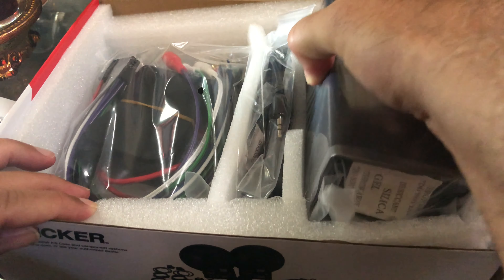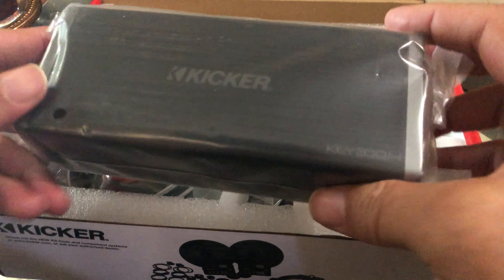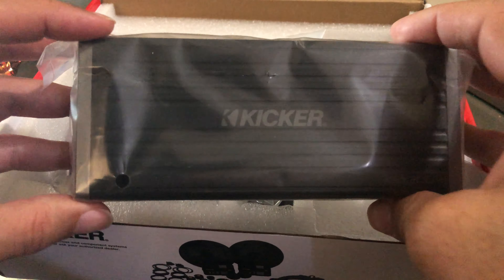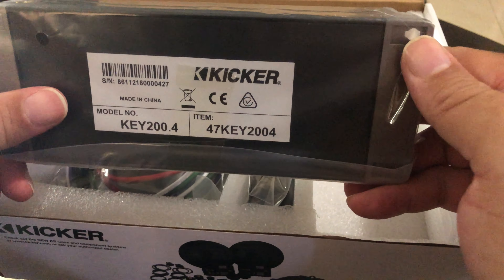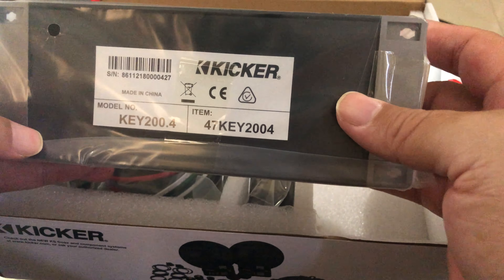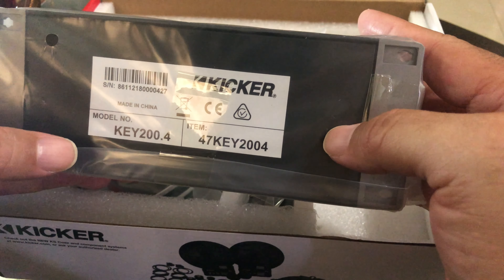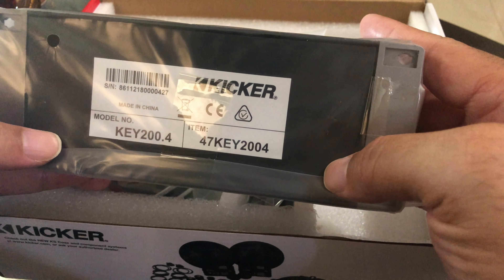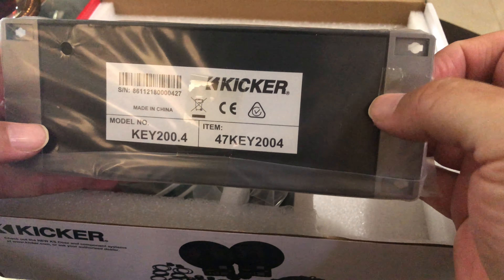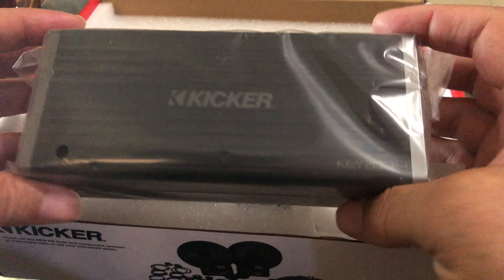What's surprising me with this unit is this thing is small — fairly small — and it's not as heavy as I thought. I thought this thing would have some heft and it doesn't. It's basically 7.5 inches by about 2 inches by 2.5 inches. This is going to fit very easily either behind the dash or there's a location underneath the shift lever. I'm thinking of using tie straps, and what I'm going to do is put four rubber feet on it for lift, and there's an AC duct under there — I can easily tie-strap it onto that. I'll add a couple spots of double-sided Velcro as well to make sure it stays in place. It shouldn't get any heat because it's going to be on top of a cooling AC duct.